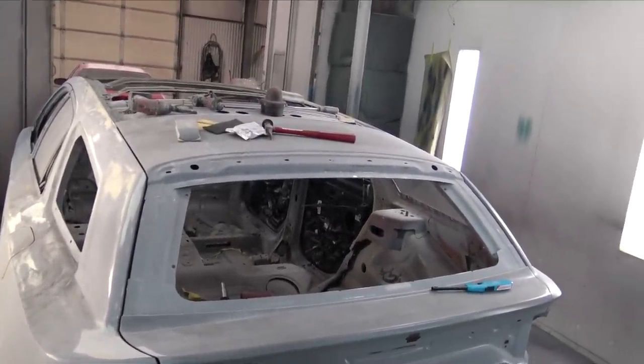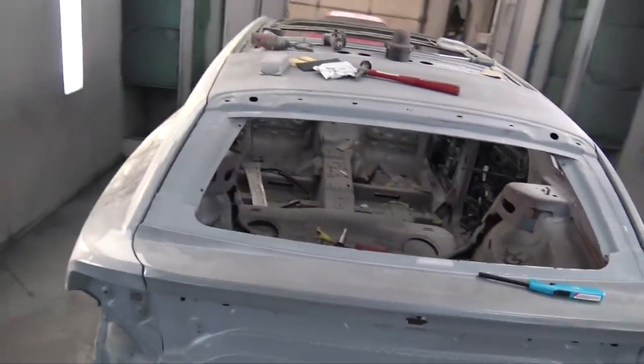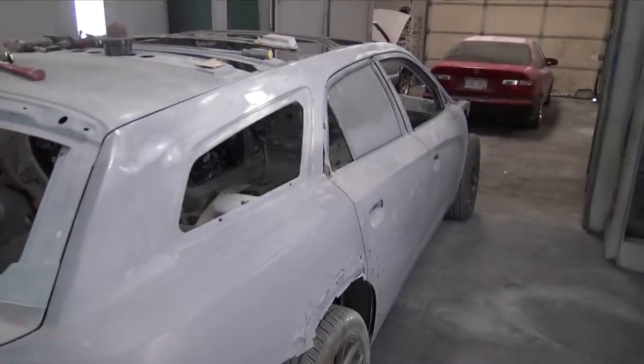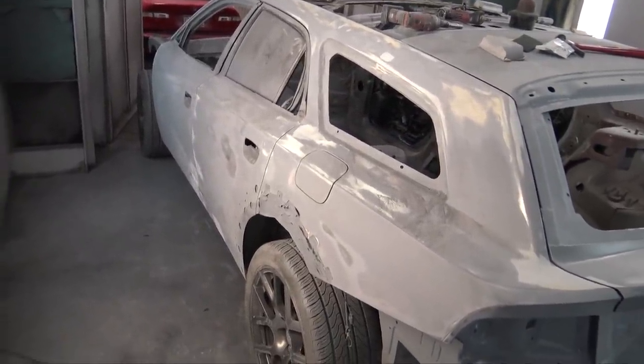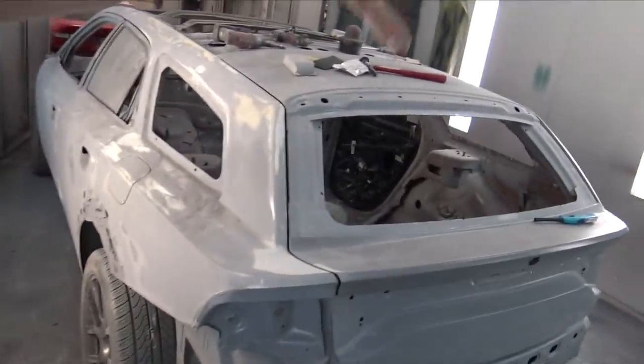I've already ordered supplies to redo it because I'm out of carbon fiber fabric. So I will need more supplies, so that if this is bad, I'll start working on painting the engine bay, finishing that wing up. I need to paint that wing. Get all these last little details, get the interior pieces I'm going to paint painted, and really, I can't get the car painted until I have the roof done, but I could seal it because I want to have it in sealer. This whole side right here is good. This side over here just needs another high build prime and then a block out, and then this will be ready. I could get this in 320 and then get it sealed as well. And then I've been working on the hatch too. So, making some progress. It's just really time consuming and slow, which is why I haven't had videos out, but let's get this part out.